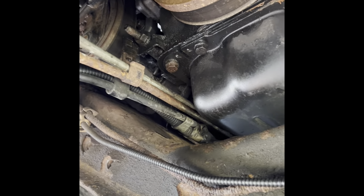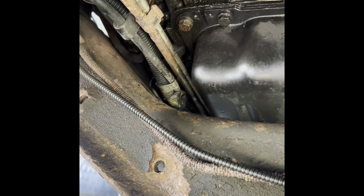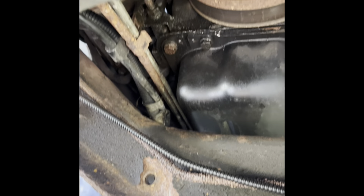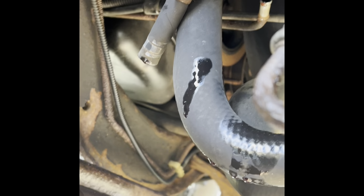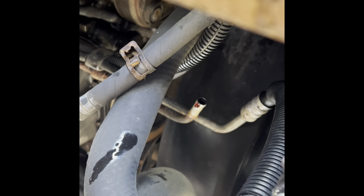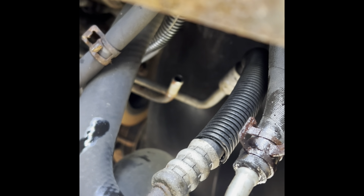The two lines are right there and they go all the way back to the tranny through the side of the engine. There's a clip you have to unclip from there too. There's the hose, there's the line, there's the pipe line. The other one is one complete section. You can actually cut the old lines to remove them if you're not going to reuse them — just cut them, it makes the job easier to remove and you can bend them however you want.